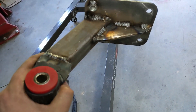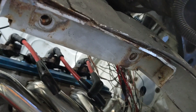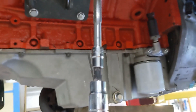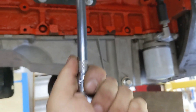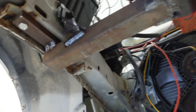Not exactly my most beautiful work, but I got a steering rack in here one way or another. Every once in a while I get lucky — these are lock nuts inside the frame here. This one was easy enough to get to with the tap handle, but the one over there had a whole bunch of stuff in the way. By dumb luck it was quarter-inch drive for the tap itself — stuck a socket on there with a torx to get inside the hex and made my own tap handle. If you squint, it's mint.